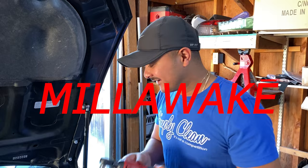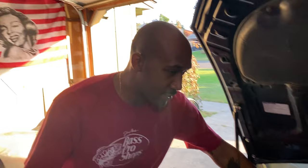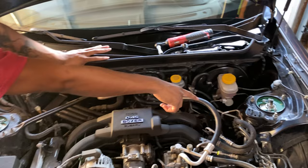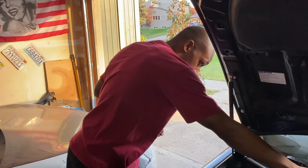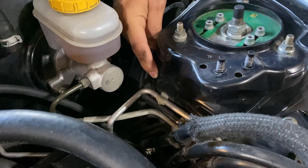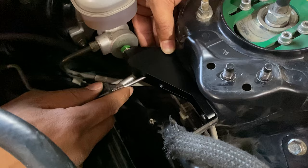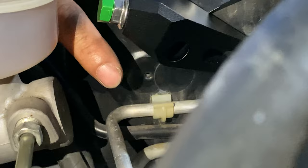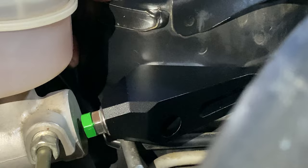All right, in all seriousness — down here there's gonna be two nuts, a nut right there, and a bolt right there to take off. You don't need to remove this but it definitely helps. Down there there's gonna be a 10 mil, so you're gonna have to use the included hardware which is long enough, like so. Then put this in there, mock it up, and take a screwdriver to poke a hole. That piece right there — I'm just gonna leave it on there, might as well poke this hole right here, boom. You can see you're gonna use that second hole right there.